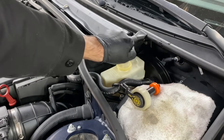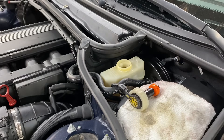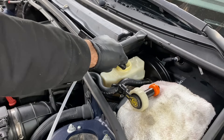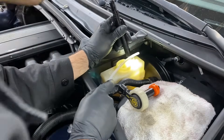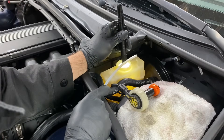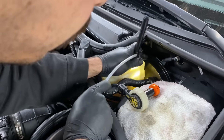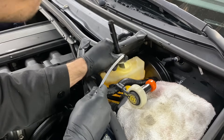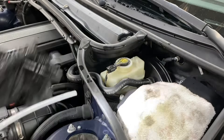We can put our filter back in — I just wanted to show you that for evacuation purposes. Now we take the evacuator, shove the hose down, and pull a little bit of fluid. Note that this reservoir is kind of two-chambered, so after you pull some fluid, fluid from the outside chamber is going to fill back up where the filter sits and the level will equalize. We want to be about a half inch below the full mark, so pull a little more if needed. With that, we should be good — throw the cap back on and we're good to go.